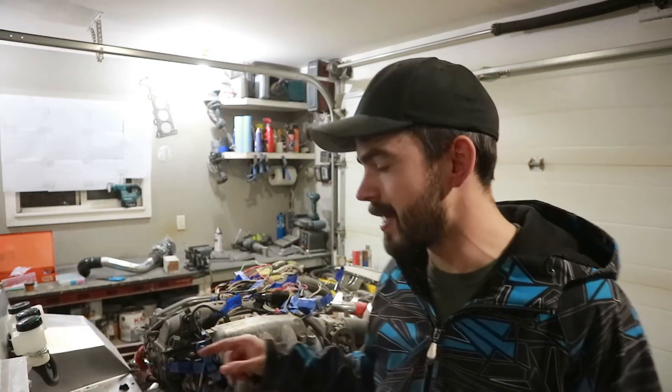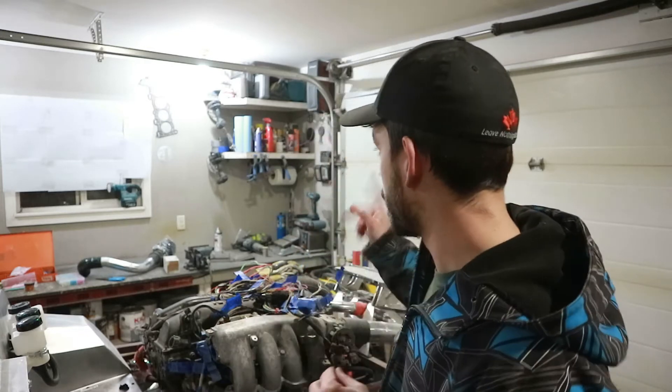I'm calling what has to be the most last-minute audible I've ever called on this car - we are not going to do anything I just talked about. I did the first butt connector crimp job here and I hate the way that it looks, I hate how bulky it is. I think once we get 30, 40, 50 of these things all bunched up it's going to be just this big ungainly piece of garbage. So we're calling an audible - we're not doing the crimp connectors, we're going to solder them together. I know a lot of people are going to say you never solder on a car because the vibration breaks the solder, but I've done it for years and I've never had any issues. So we're going to solder all the wires together and heat shrink them - hopefully it'll look a little bit better and take up less space. I'm going to grab my soldering iron and flux and then we're going to start all over again.